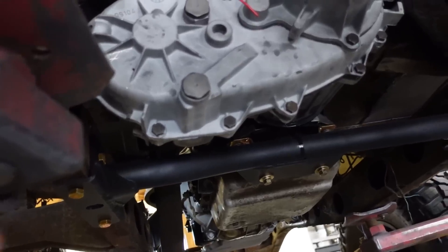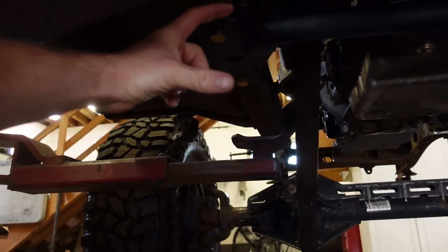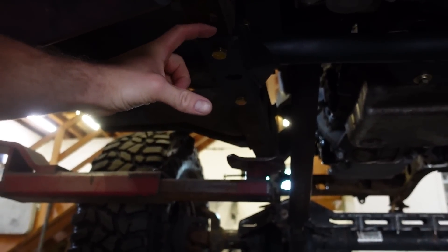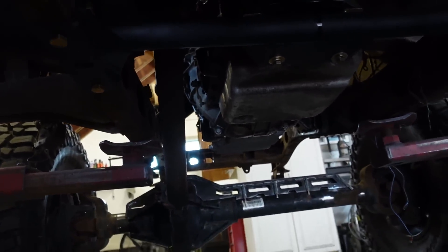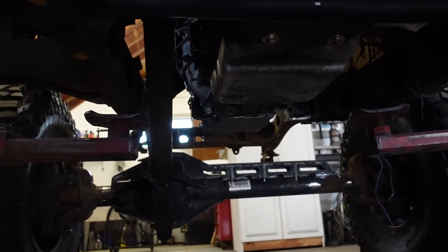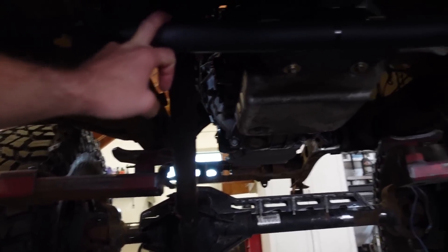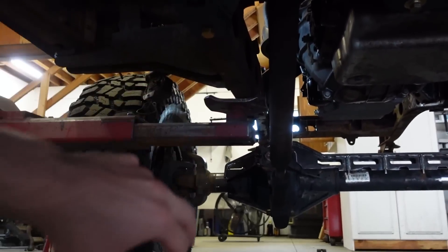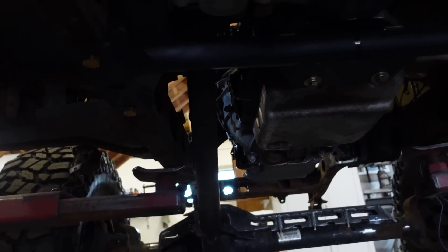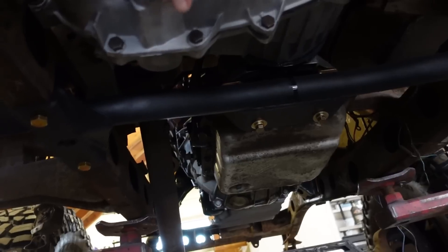Now I know I spent so much time trying to get everything tucked up, and I might scrap that idea just because my link mounts are going to be hanging down right about here, and that's going to be lower than the transfer case. I can just build a little skid plate for the transfer case if I'm worried about that. I'm going to try it and just see how much clearance I have on my crossmember. I don't want to completely rebuild that crossmember but I may have to clearance it a little bit. So let's pull the transfer case back out, pull that plate off, throw the transfer case back in just like factory, and see what we're looking like.